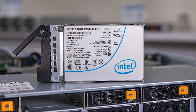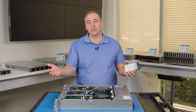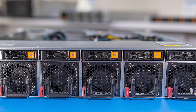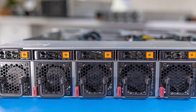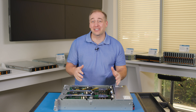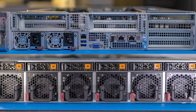What's a little different on this system is that the U.2 bays are on the rear rather than the front as you'd normally expect. Because we have all this IO on the front, you have to put storage somewhere — and it's still hot swappable from the rear. You can just pull out the drives from the back, serviceable without getting into the system. In previous generations you could only fit five two-and-a-half inch drives across, but this system actually fits six because they're using higher density trays. One other small detail: there are service tags both on the front and the rear of the system, whereas normally you'd only see one on the front.